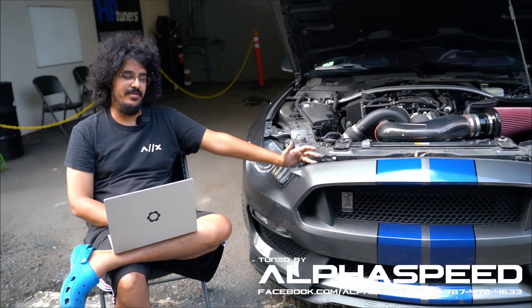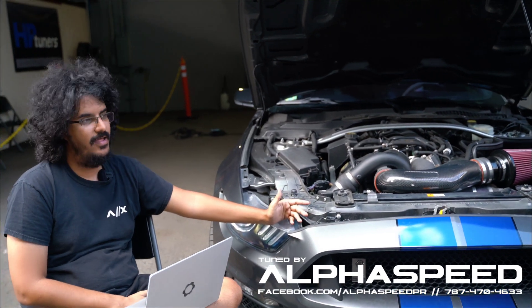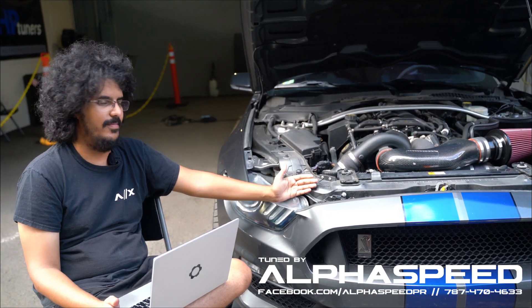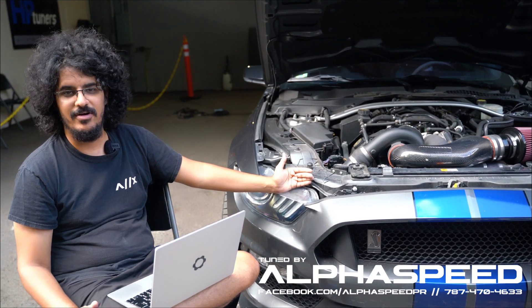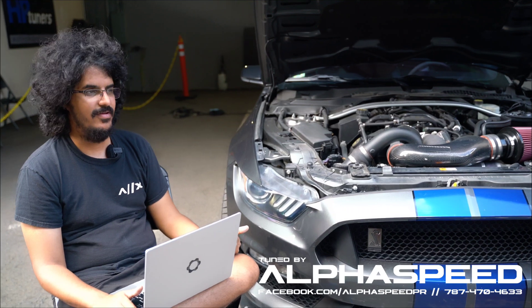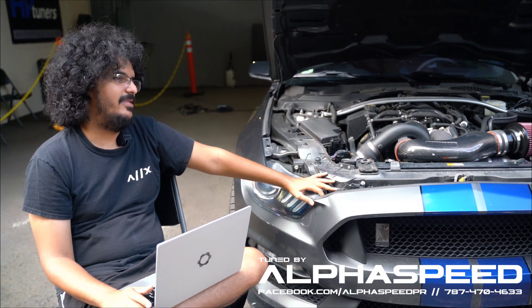These torque tables are important because if you don't put in the correct torque values — say you supercharge it and your torque tables aren't updated — then when the car sees it's making way more torque than it's expecting, it'll start going into limp mode. Many of you have seen the magical Ford wrench light that tells you you're in limp mode. That's usually because the torque management system is going crazy, saying 'how is it making so much torque when the torque table says it shouldn't be?' You need to recalculate all your torque tables and make sure they're at least somewhat close to reality so the torque management system stays happy.